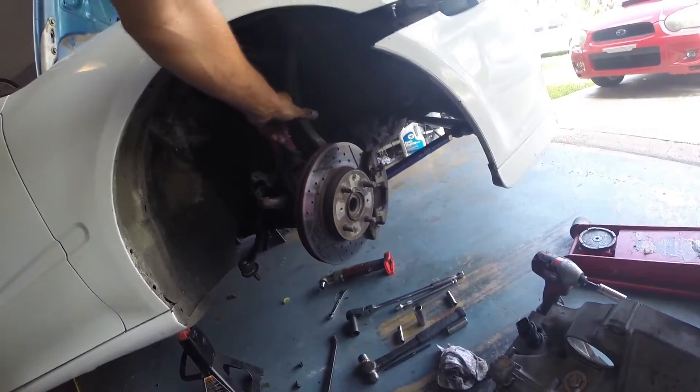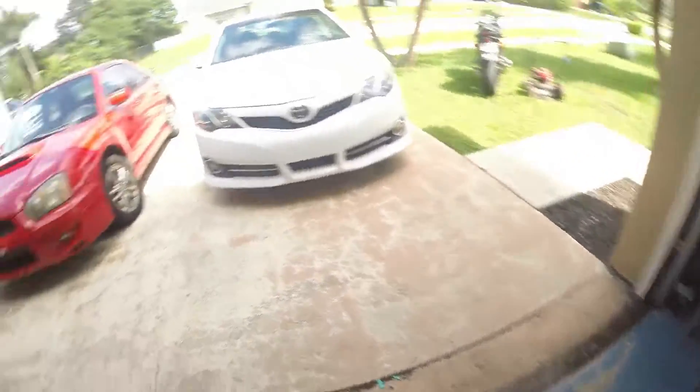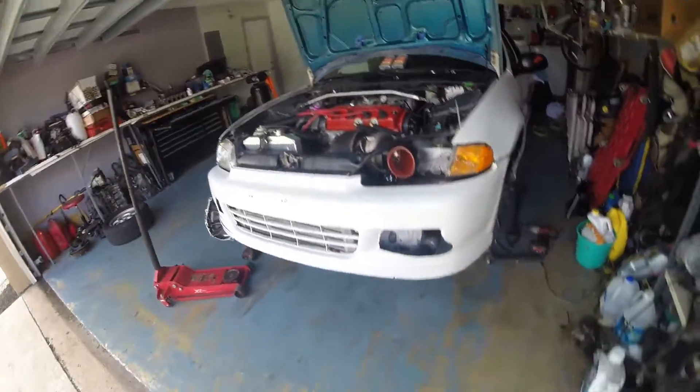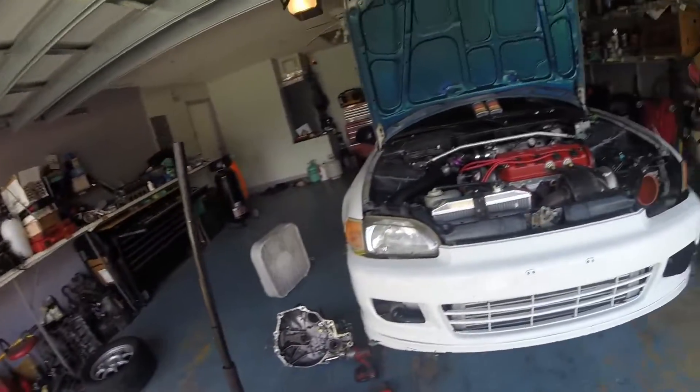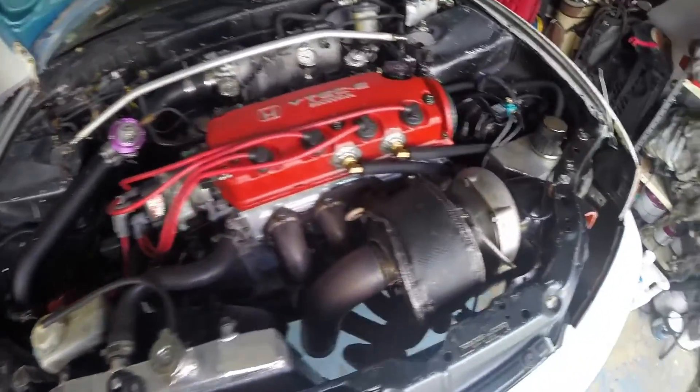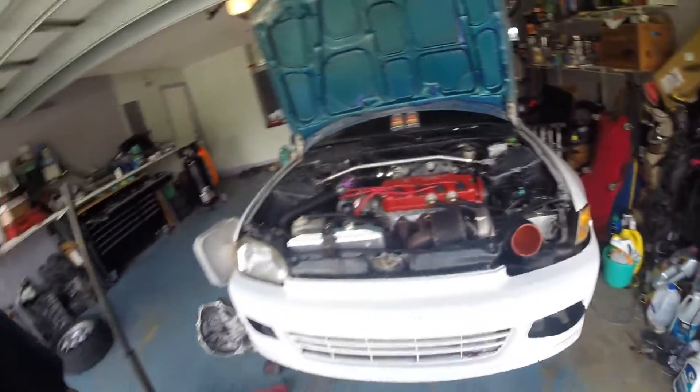Alright, that's that — it's done. I wasn't even trying to go fast. The only thing I've got to do now is pop the axles in and the tires. I'm actually going to replace the front brakes with the 95EX front spindles. This is a 93DX body, so it's got the little 8.8-inch rotors. I'm going to take those off since I'm already this far, pop them off and throw the 10.2-inch rotors on, front spindles, bigger calipers, bleed the brakes, put the bigger master on — all that jazz. That was about 45 minutes to do, and I wasn't even really trying to go fast. It's very simple. Thanks for watching, and we'll do a test drive shortly after I do the spindles.